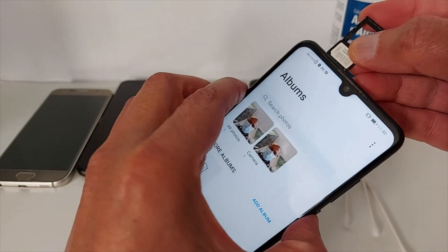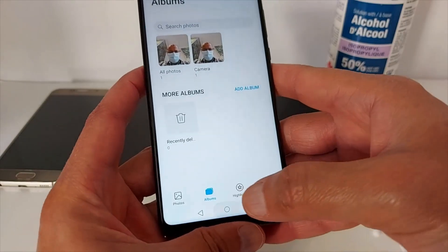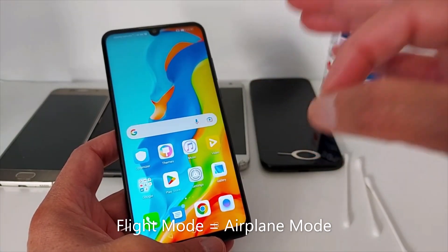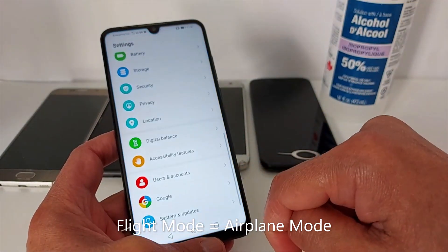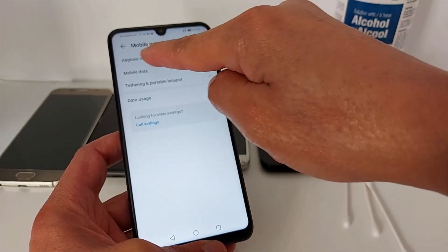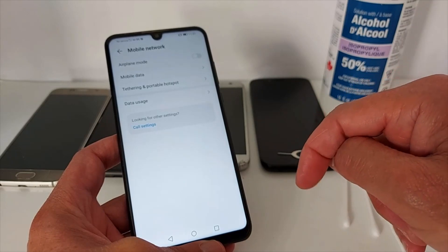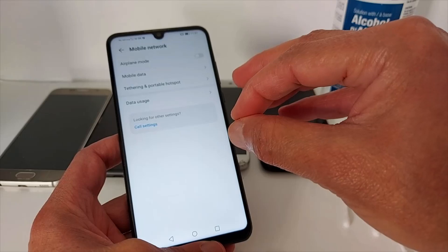There is only one way to insert the SIM card in the phone — it's done. Number five: there is an option in your iPhone or Android phone called flight mode or airplane mode, depending on the model. Go to settings — in my phone it's in mobile network, and airplane mode is right there. Turn it on for three seconds and turn it off. That refreshes the SIM card network in your device.